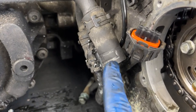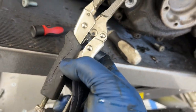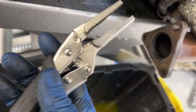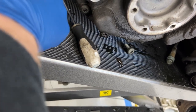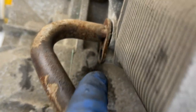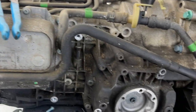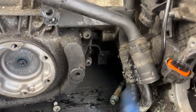Just to document what I did here: I pulled that hose clamp off — these are my new favorite hose clamp tools, by the way. It's just this little alligator-looking locking tool. I set it to the correct distance and just lock it on that ring, and that way I can move it up and down without having to keep squeezing it, which makes it really handy. I disconnected this bolt which was a T-40, and the one back here that was also a T-40 — just these two. This one is a bracket and this one is the actual connector, so it was free and I could twist it and pull straight up and got that disconnected.